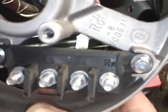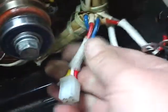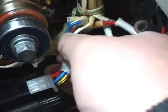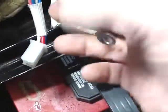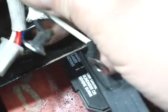Here's the end bell — you've got your wiring posts marked L1, L2, R1, R2. It's pretty simple. You've got the plug that your AVR connects to, and then you have two groups of wires: a black and a white on one, and a gray and a red on the other.